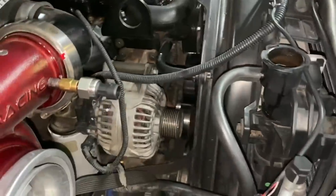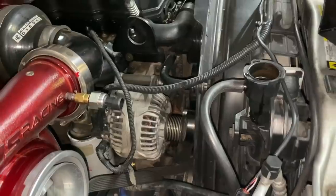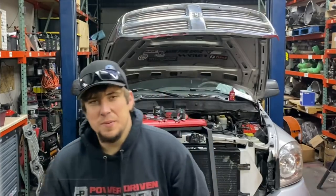We've got our water pump reinstalled. Just go hand-tight on the bolts - use your best judgment. Throw the belt on and you're done. That wraps up tonight's video on clipping your water pump. It's really simple to do. I've seen a lot of guys not know how to do it or completely butcher it. You can remove just two fins and leave three, but there's got to be some kind of balancing consideration at 5,000-plus RPM.